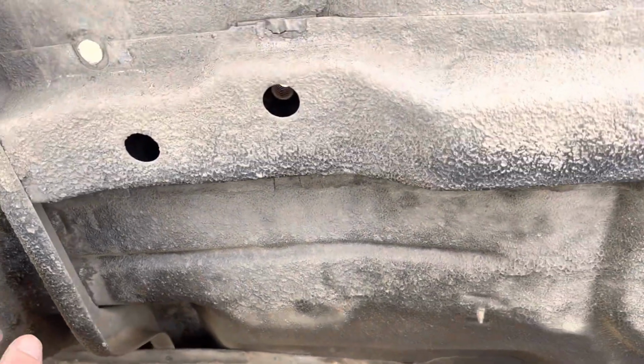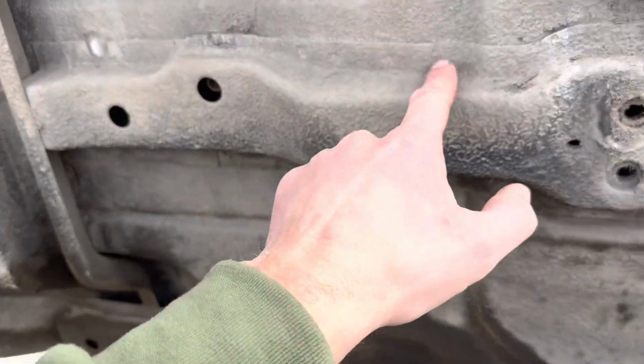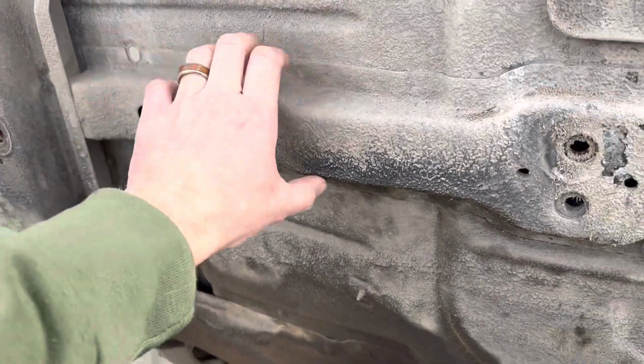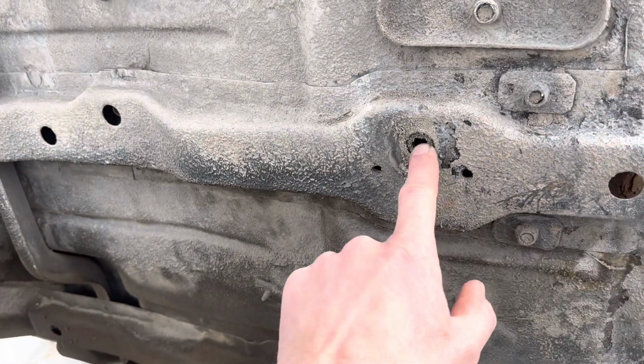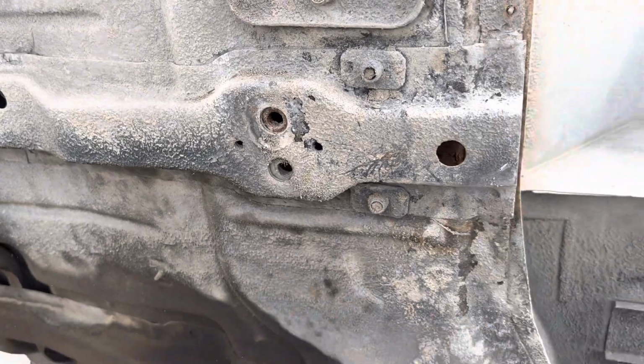And then these guys here, again, this is more of the difficult one. You can see all the spot welds that go down. If you were to do it right, you'd replace this whole entire section here. Your torque pocket itself or your bolt hole there is right here.